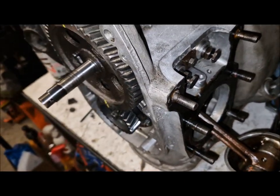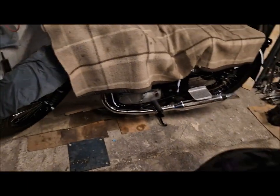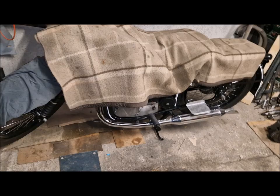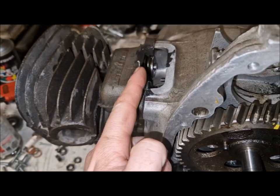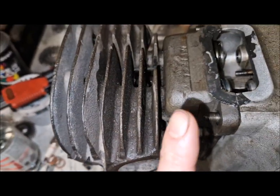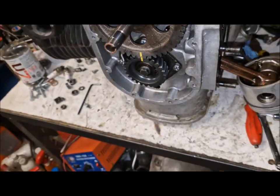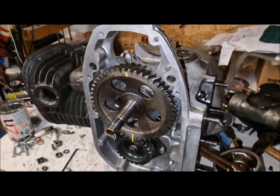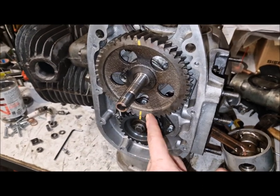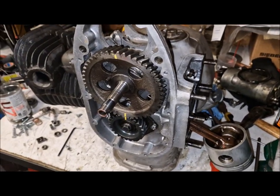If you have an engine with only one cylinder, like the BMW R35, you will put the cylinder on top dead center but not in the firing position. So now I have the correct marks, it is all verified, and I just have to assemble the engine.